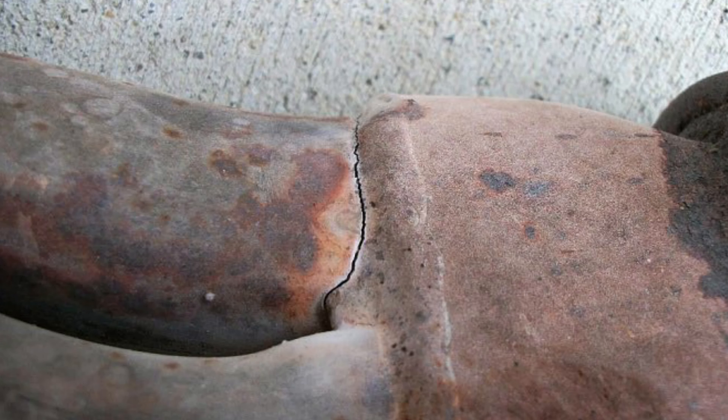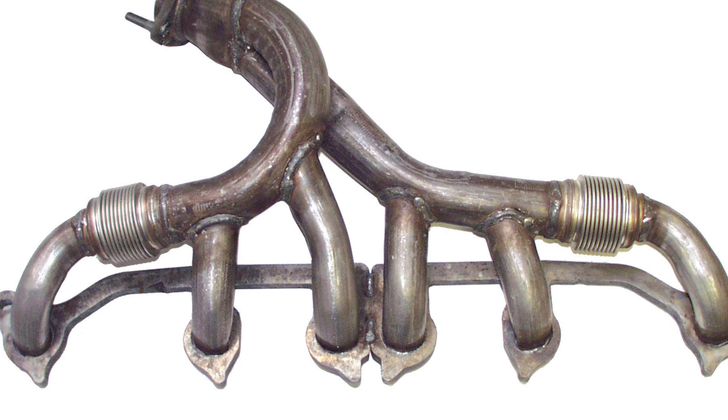Another thing is with a Jeep Cherokee — with the older ones, the newer ones not so much, like the 2000 and 2001, it's usually just the gasket on the manifold where your exhaust pipe meets. But on the older ones, '99 and down that had the single manifold, those tend to crack. It's the way they're designed, the way they're welded, and how thin the pipe is. When that motor begins to flex, it actually cracks the manifold. Super easy to fix — takes about an hour or two. Anybody can do it in their backyard. You can buy a manifold that has flex pipes in it, so when your motor begins to rock a little bit, the pipe will flex and keep it from cracking.